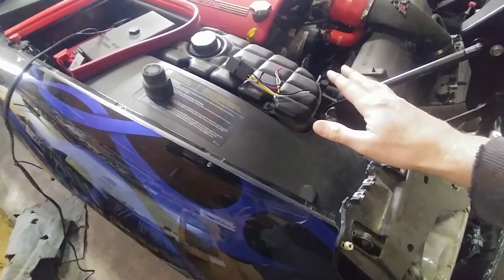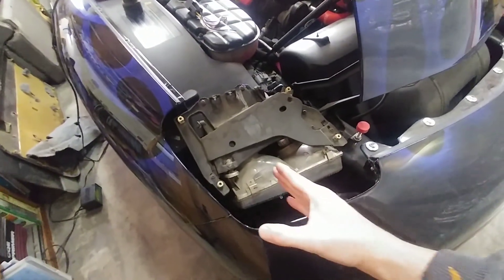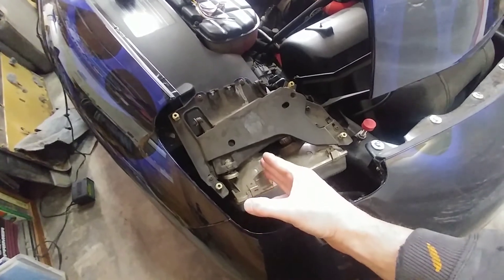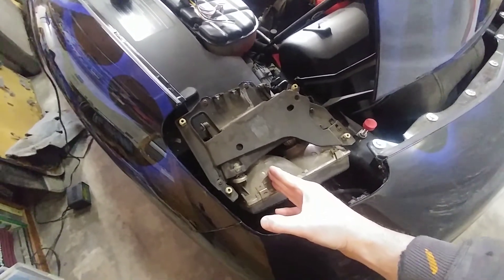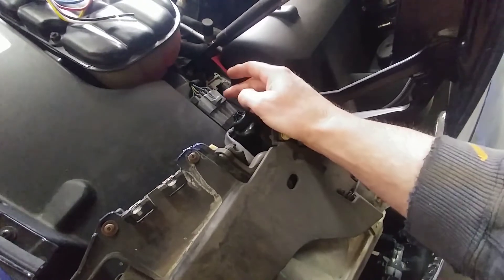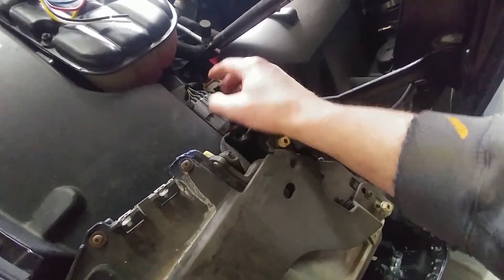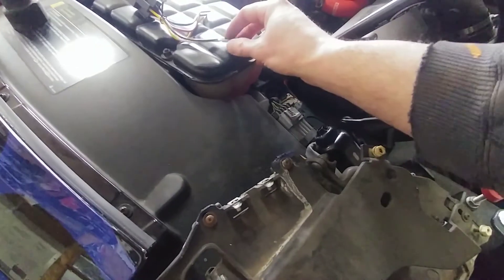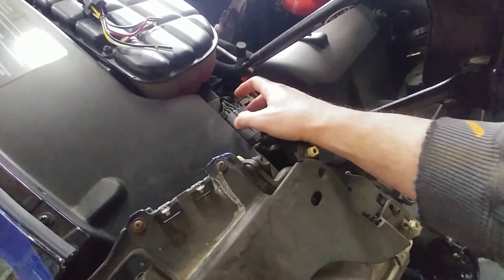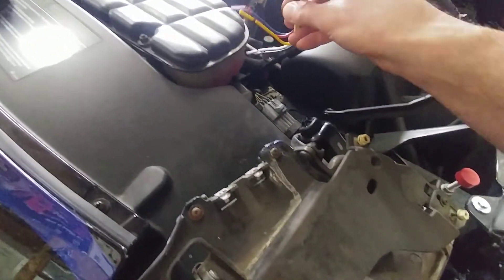Now that we know what the relay needs to do, we just need to know where to put it. I've taken the cover off here for demonstration. The low beam light is the outside and the high beam is the inside, so we're concerned with the wiring for the low beam. On the passenger side, that's a set of blue wires. Coming into this connector you have a green and brown for the high beam, and a light blue and dark blue for the low beam. So you want to add the black wire to the dark blue and the white wire to the light blue — just figure out where you want to splice them.